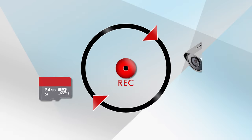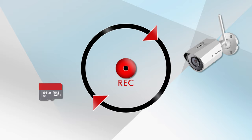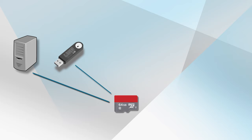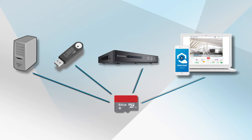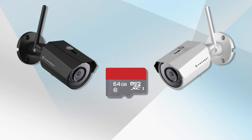For efficient usage of your storage card, your camera comes set up by default for cyclical recording, which means it will automatically record over the oldest video footage on the card with the newest video without the need to delete old content manually to free up space. Please note that you will not be able to access older video that was recorded over. This option can be changed manually from the menu screen if you do not want to record over your content. You will have full control over your recordings and can manage them however you would like. To permanently save or backup all your recorded content and clear the card to reuse it for future recordings, you can backup the content from your card onto a local computer hard drive, USB flash drive, Amcrest NVR or cloud storage via Amcrest Cloud, and then delete the content from the card. Please select the best suitable option for your specific situation or needs.